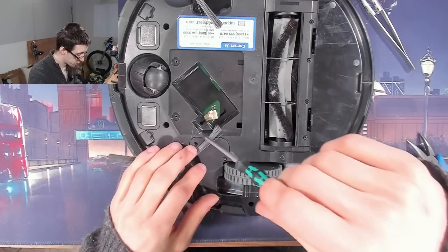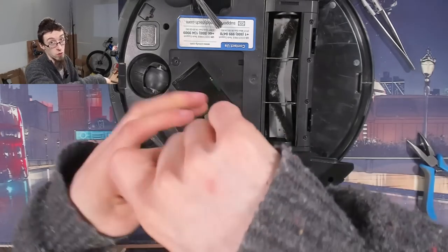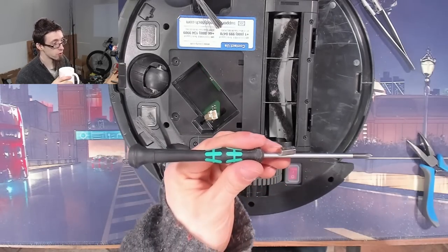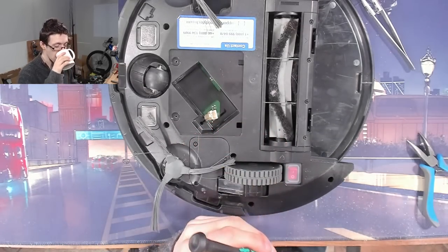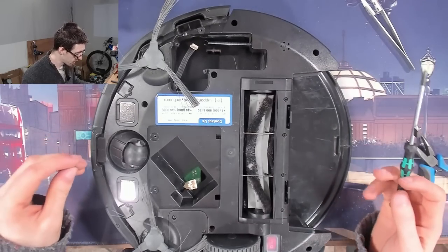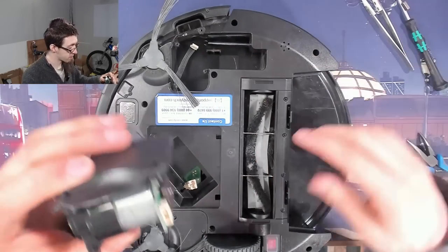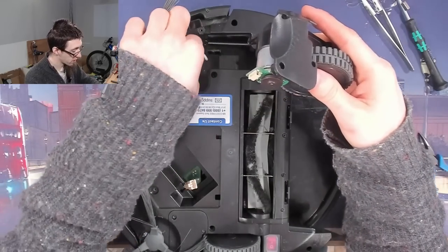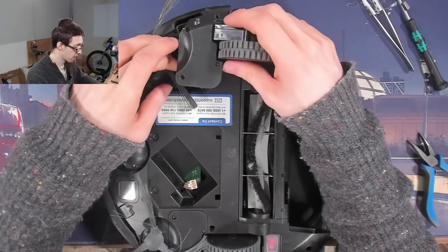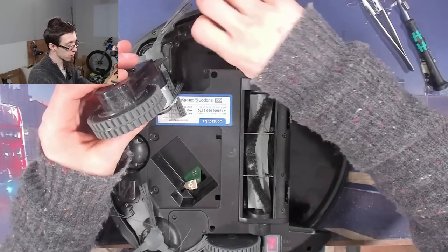This device is just big enough that having larger-handled screwdrivers would be enormously beneficial. Normally I'm a big fan of thin narrow screwdrivers because they're much, much faster. However, when you've got a thin handle you have a lot less power. When you're in a laptop or on a desktop computer you don't need power, but when you're driving screws into plastic like we are here, suddenly you need a lot more torque.